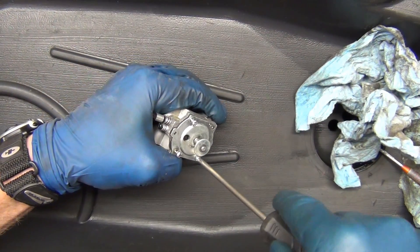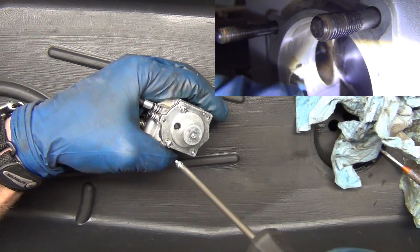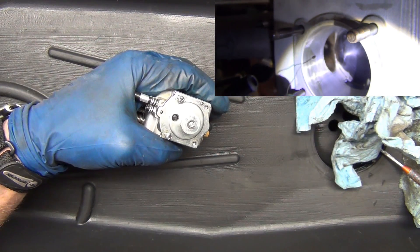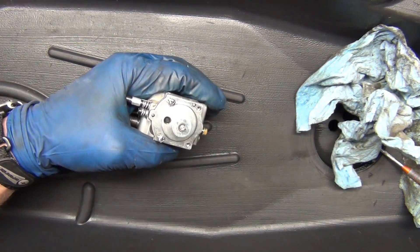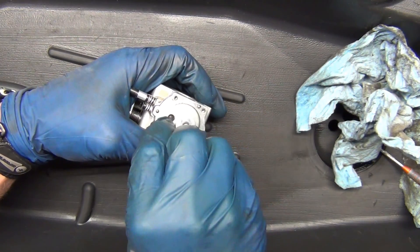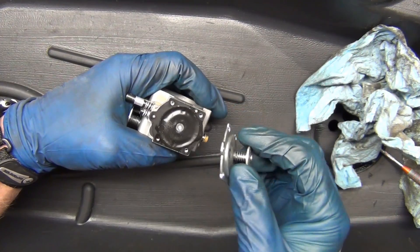My paramotor has been a little bit hard to start. I've checked the decompression hole in the cylinder and it's just completely clear. There's also been a lot of fuel leaking off the carburetor, and somebody used pump gas in this for a long time without using Clear 88. That causes these diaphragms to just go to crap.